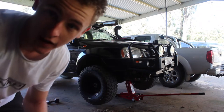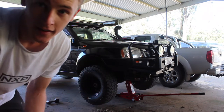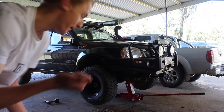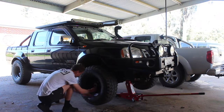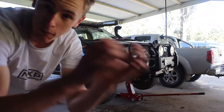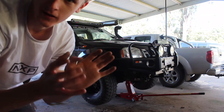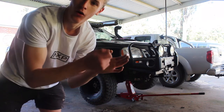Now that the tyre's on the car, I'm going to get all six lug nuts — one six stud — and I'm going to put them on, just around on every single one, just fingers tight, and then I'll come back. I was moving it back and forth while tightening it, so I can make sure it's kind of like the perfect center spot while doing it up.